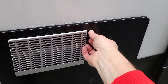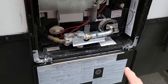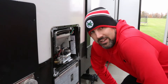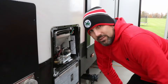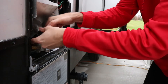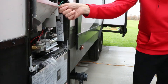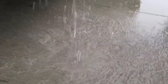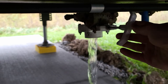After the low point drains, find your hot water heater. The hot water tank model will be different for different units. This particular one in the Grand Design does not use an anode rod, so all we have to do is remove the drain plug and let that drain. I'm a big fan of socket wrenches, but because of this little piece in here I can't fit the socket in — if anybody has drained this model, I'd love to know how you do it. Then you can open your pressure valve. You'll also want to drain your fresh water tank. Grand Design gives you these nice 2-inch valves, so this doesn't take very long.